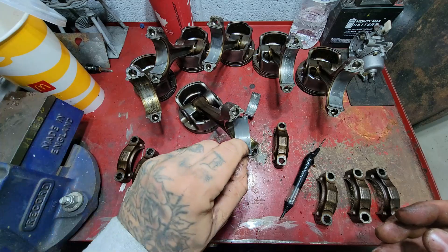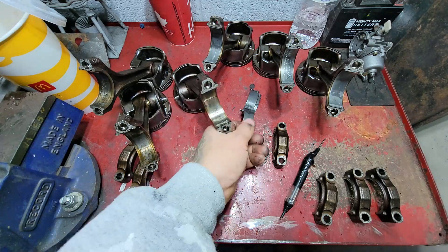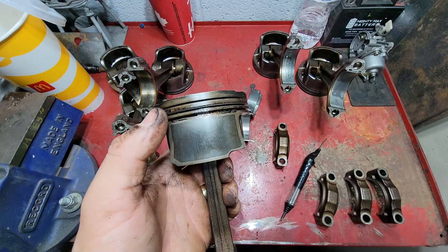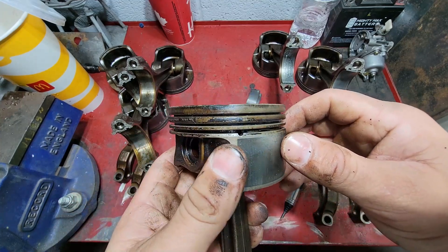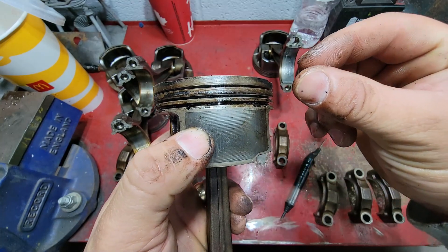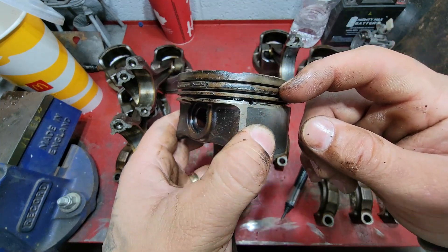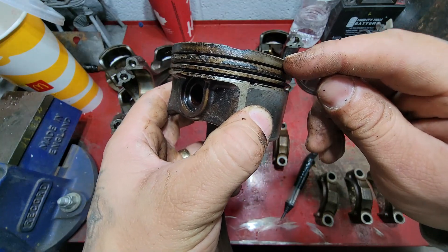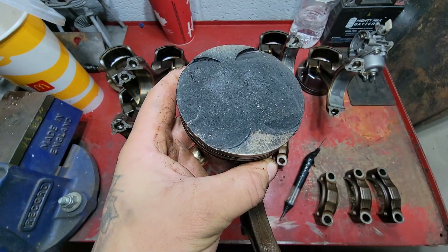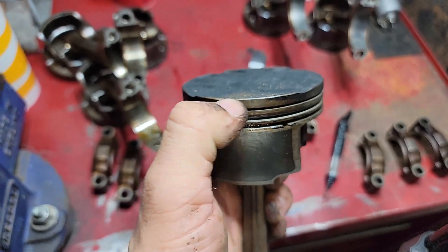The ring gap is a very important piece when boosting an engine with cast components. When you increase boost you increase temperatures, and as things get hotter they thermally expand. Because these pistons are cast aluminum, the compression ring can overheat and become so tight that it butts up together and over-expands to the point where it can't contain itself in the ring land anymore. The ring land will actually break the top portion of the piston, and you'll lose all compression in that cylinder. I'll show you an example — the outside of the ring land had completely destroyed itself and obliterated that piston, so there was zero compression in cylinder one.